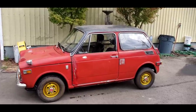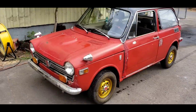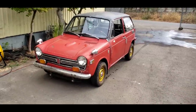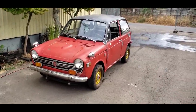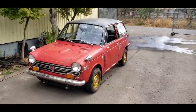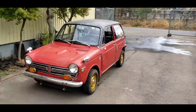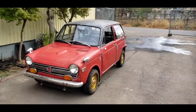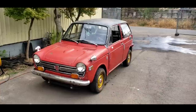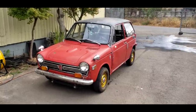I'll let you know in a few days how that's working out. So far it seems to be doing just great — perfect. Love this little car. Can't wait to rip it around. I think once the rust gets off the rotors and the brakes bed in a little bit, it will become even better. The old master cylinder didn't have enough oomph to really stop the car. Thanks for watching. Hope I helped you out, or maybe started a new trend on converting brakes for old Hondas. Let me know in the comments. Thanks, bye.